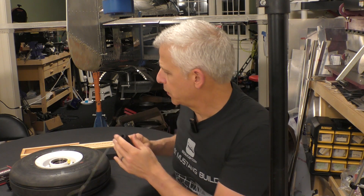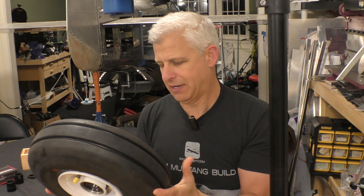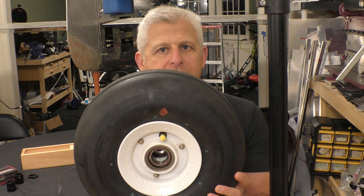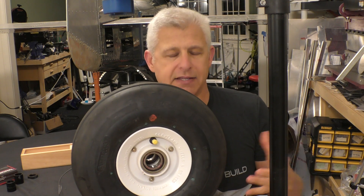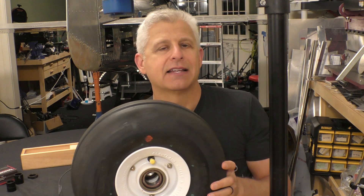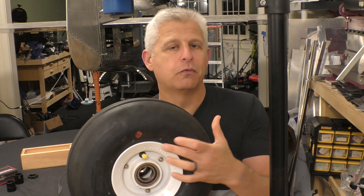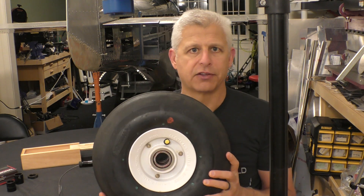The first thing we need to do is put the tool into the tire itself. I have this brand new Michelin Pilot tire — a gorgeous tire with a lot of tread that will last a really long time. When you look at the tire, you see this red dot. The red dot represents its lightest point — Michelin does a quick balance and marks it. You generally line that up with the valve stem, because that's expected to be the heaviest point of the tube assembly, and to some degree they cancel each other out.